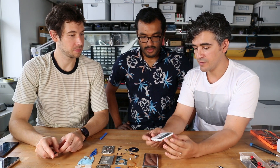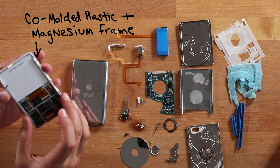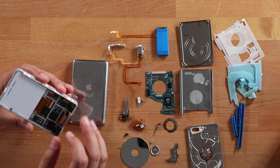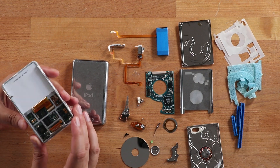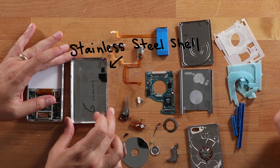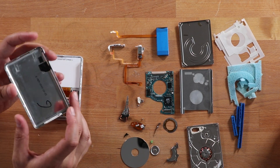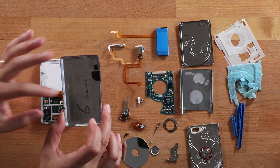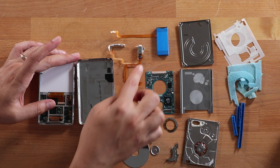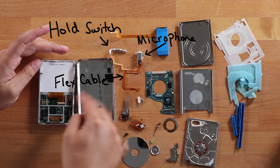So we got the iPod apart, split into two halves. The front is a co-molded clear plastic and white plastic, and then it has screwed to it a magnesium frame. The magnesium frame traps the PCB and the screen — the screen is this beautiful white module, I wish they still made things like this. Really similar to a contemporary electronic device, everything's connected with ribbon cables. On the backside we have this stainless steel shell — it's got some laser-welded latching components around the edge that fit with the magnesium and plastic here, so it just snaps together. It's probably the most beautiful snap fit that's ever been designed, and it's a design used in a lot of products today. Screwed into the welded steel components are the hold switch and the microphone on a common flex cable, and they did all the amp stuff around the microphone so they didn't have to run it on heavier gauge wire from the main PCB.